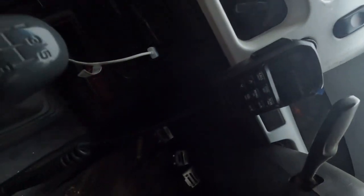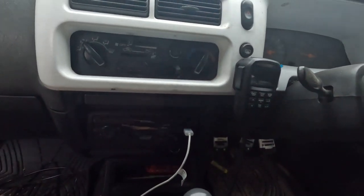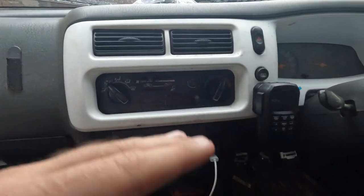I've just realised that before I mount the unit I needed to mount the handpiece. I've gone and put the handpiece just next to the steering wheel — it's easy for me to read and just out of the way. The reason I'm talking about this now is because it's probably a good idea to decide where your handpiece is going to go first. You do get a lot of pass-through cable and extension cable, but it's good to mount it where you want it to end up and then adjust your control unit mounting accordingly.